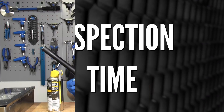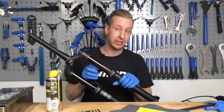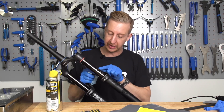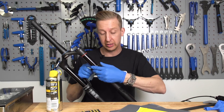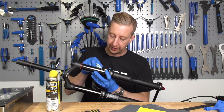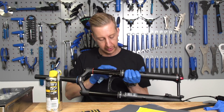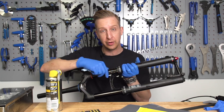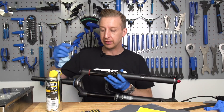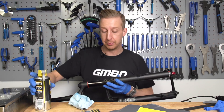That is the job done. That is nice and smooth and it's going to pass back through the seals without hindering them. Of course, the scratch isn't covered up — you can visually still see it. If you're bothered about it, you could color it in with a different color filler. I'm quite content with this. I'm going to give it a nice clean up with some silicone spray, make sure there are no bits from the filing anywhere around the seals, give it a good clean, and then it's good to put back on the bike.